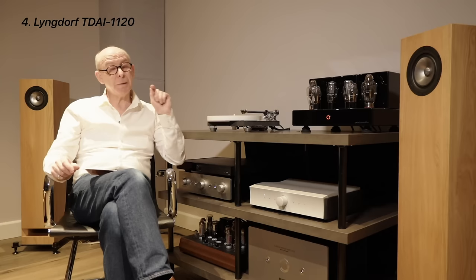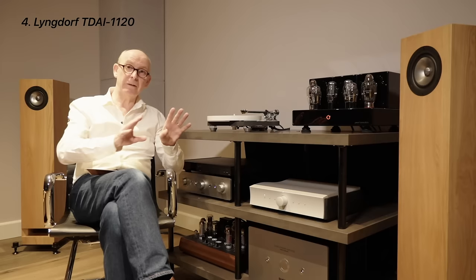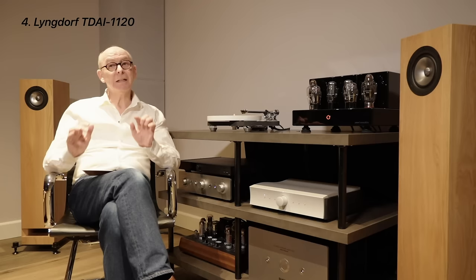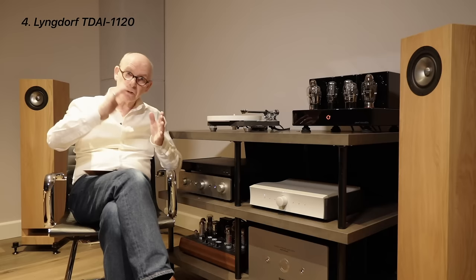A little warning for Sibelius owners: if you're going to go with an 1120 and you want to set up Room Perfect, contact us because we've got a special document telling you how to do it, because you've got to be careful. But it's really a fantastic preamp. I wish it was a preamp. The reason why it's not a real preamplifier is you don't have a lot of inputs and you don't have a lot of outputs. But it is also a very, very good, clean amplifier. It's about 60 watts per channel, if I remember correctly, and you've got lots of controls and settings, so you can hold it back or you can boost it.